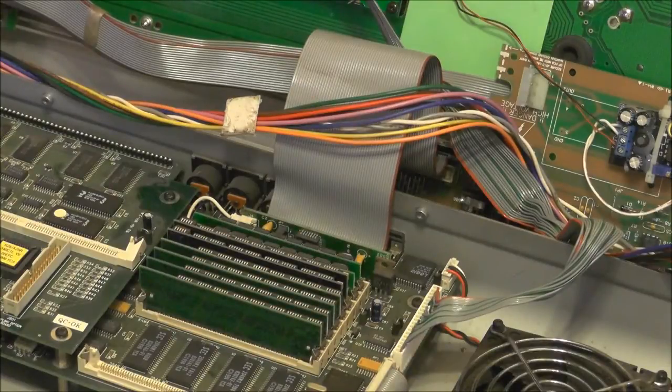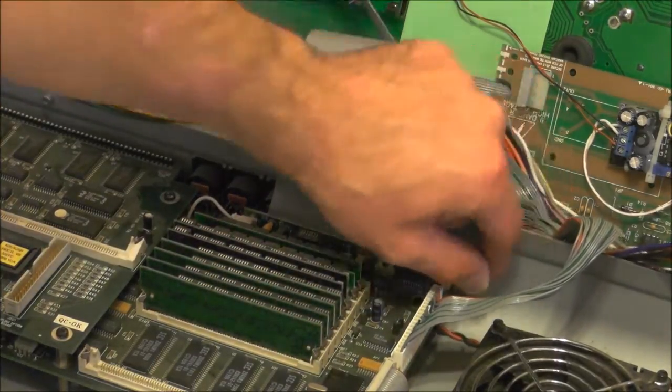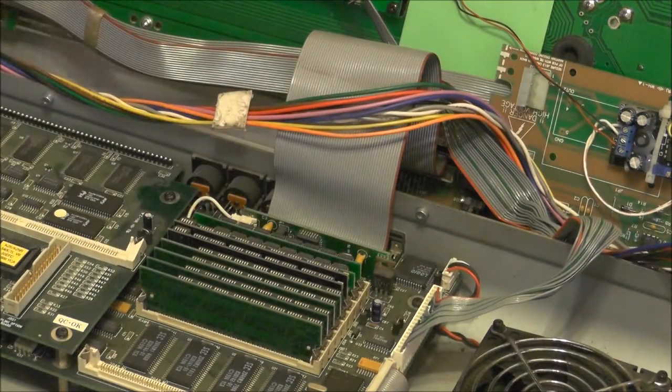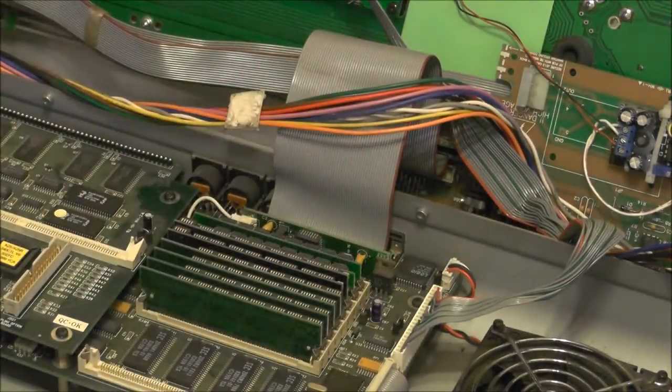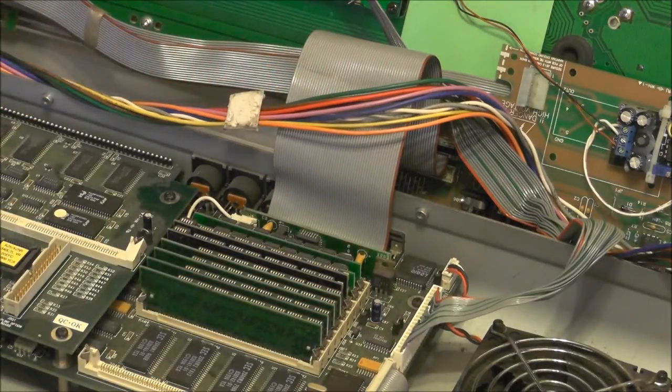I've had to play around with the floppy disk and I can't get it to work at all — whatever I do it doesn't change anything. I've tried the new one and that does exactly the same thing. What I have done off camera was to go around and check the voltages, and I've noticed there's no 12 volts coming out of here. This is the connector that runs down to the floppy drive to supply the power, and there's only 5 volts on there. You would normally expect to see ground, 5, and 12 volts, so that might be the issue. It's a bit disappointing really — I was sort of hoping I could make a bit of progress on this today but sadly not.